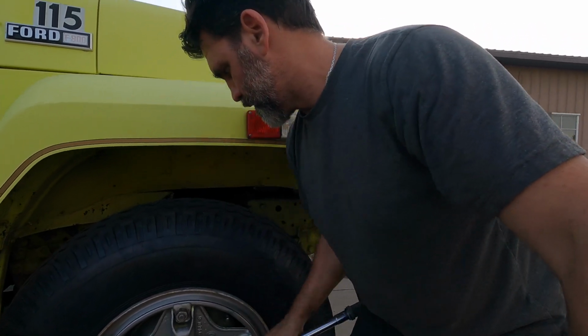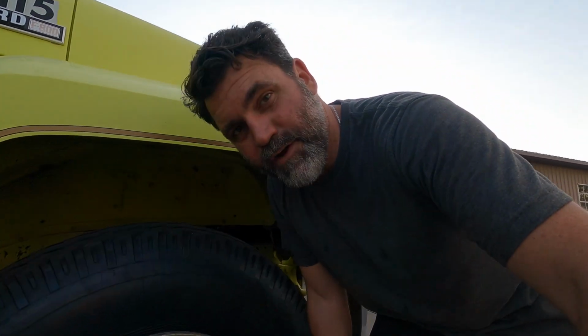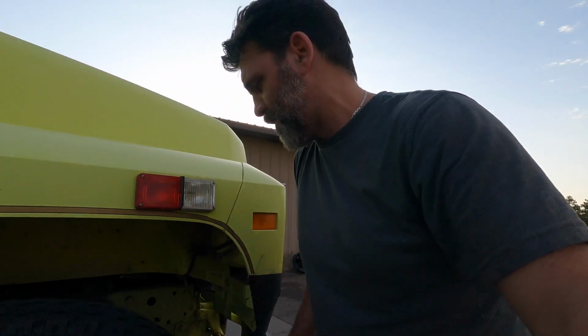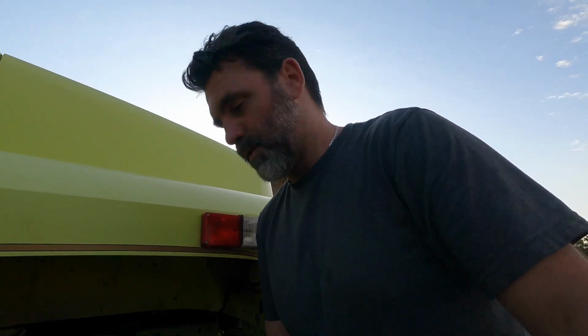Ooh, that one was plenty loose. What else did I do? Something very important I'll remember. Oh, adjusted the carburetor. Hello. Adjusted the idle mixture. Oh, I forgot. I should set the float level.